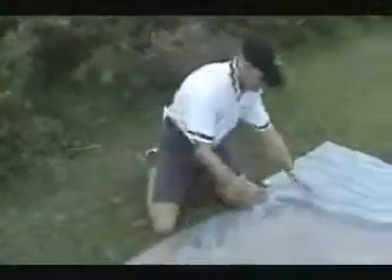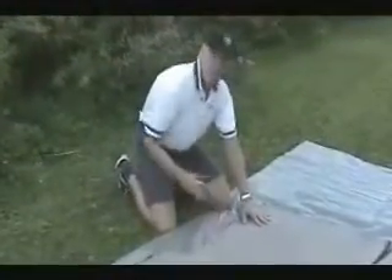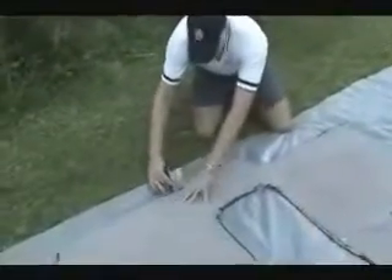It's really just a simple matter of tracing around the perimeter of your carpet. Accuracy is important, so make sure your Mylar is flat and your carpet is flat and without wrinkles as you're marking it. Notice in this corner I've got one of the female snaps — I'm just going to mark that location because at the end I want to indicate how many snaps I need to complete this install. For all of your radius corners, make sure they're marked as closely and accurately as you can. Any little nuance, any little turn is going to be in your template.